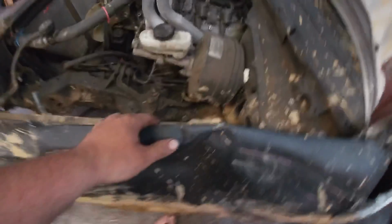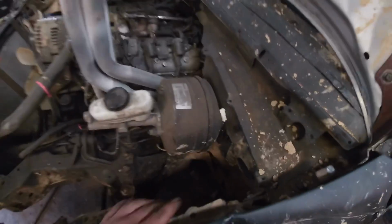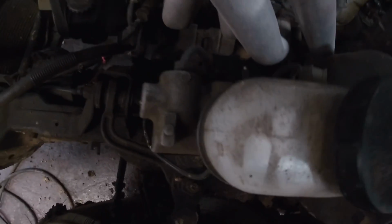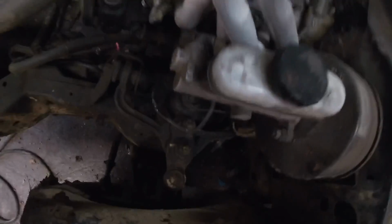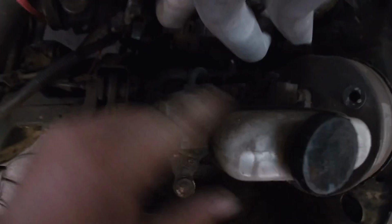Because, well, I was originally going to run all brakes, but we ended up just running front brakes. Which actually, that is 1/4 inch line. So this one actually, I'm sorry, that was wrong. This is off of No2. This is the original one, because look, that's 1/4 inch line. It's hard to see, but that's 3/16. So that's the problem I ran into.